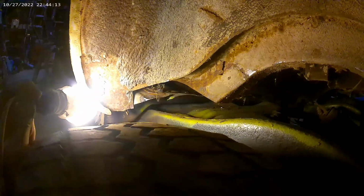But right now we are working on, I wanted to be able to get this back end down farther. I had to cut the spare tire holder out so that I could drop the body a little more because it was hitting the frame. So we're gonna use a stop sign that I had hanging on the wall. I don't know if you can see that. Put some body mounts in up here. Probably just weld a plate in and then mount it. End up getting welded over here once it's down far enough. But yeah, that's where we're at.